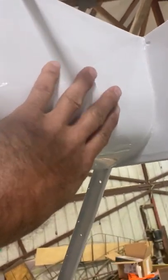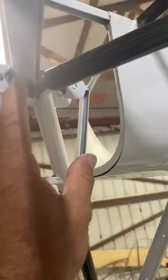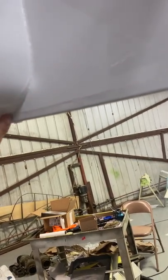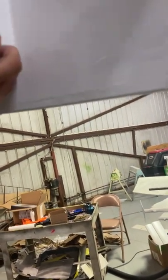We usually, over at Central Arkansas Aircraft Repair, will go ahead and trim all this stuff out and maybe put aluminum right here. That's going to be bedded in — your covers will be screwed to this. That aluminum edge allows this piece of fabric to actually slide behind it and get glued in, and then this one can get glued in as well.